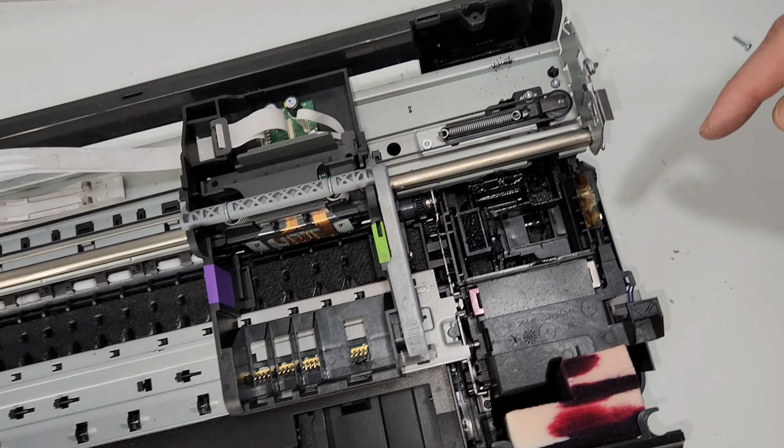So the timing strip, you just push it to the left and you remove it if you need to replace it. Usually if you're replacing it, it's already ripped off. Keep in mind, you can always put some glue, even though I sell a lot of these, but I don't have this particular one. These are very rare, and if yours broke, you can always put some tape or something, because the area that does not have any of this tint, you can play with. So anything on the left side of the dot, you can just use your own imagination and fix it, as long as it attaches to this latch. And same thing with the right side. So that's something to keep in mind. On other printer models, I would have it ripped, and that's how I would fix it. I didn't have to use the ones that I have or buy another one.